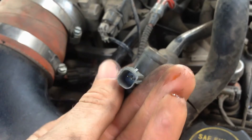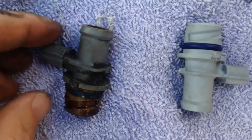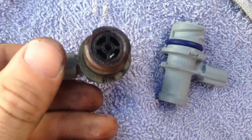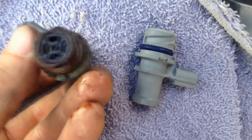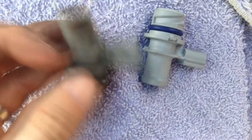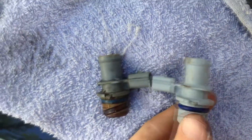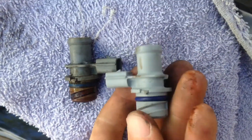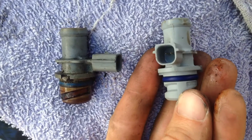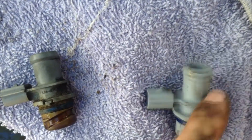We're going to pop the new one back in, which looks exactly the same. One more thing — if you know your valve is good, you can clean it with some carb cleaner and pop it back in. Obviously if it's bad, get a new one. Make sure it's the exact fit, and as mentioned, don't go aftermarket since these are calibrated to your engine. We'll pop the new one in reverse order and we're good to go.